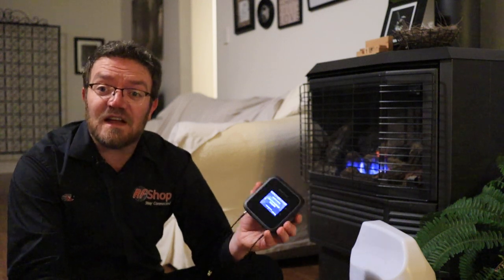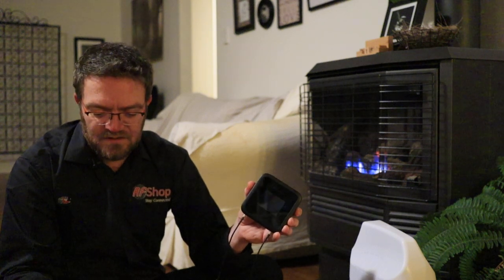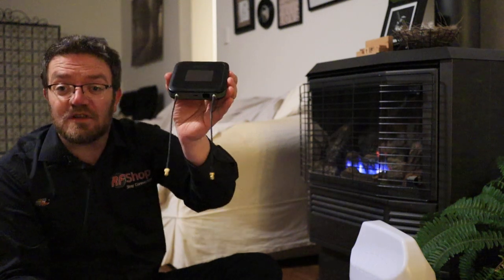The screen recording stopped — restarting it now. It now says Telstra 5G, so it's really looking for a 5G signal. The readings have changed to RSSI instead of RSRP because it's switched technology, and it's now showing LTE band 3. It may be falling back to the internal antennas because it disconnected from external ones. This is where it gets hard to judge — the device switches between what's available internally and externally, which makes it very hard to demonstrate where the signal is good.